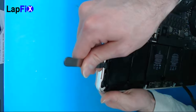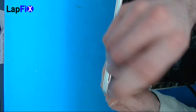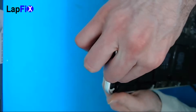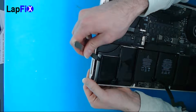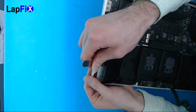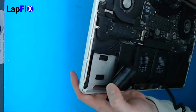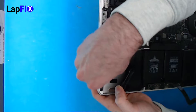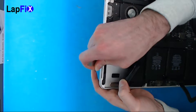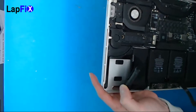You can kind of hear it rip a little bit — you can hear the adhesive coming unstuck. That's always good news. If it's still a little bit of a struggle, you can put a little bit more alcohol. You can hear it now, how it comes up and pops a little bit. Just go really slow, get a feel for it — you can hear it tearing off. It's coming very nicely. Not that much effort there. Once that's in, you can get this one out of the way. Keep spraying as you go — the more alcohol you get in there, the better. Why they choose to adhere this is a little beyond me, but if you ever did need to remove the battery, this is what you need to do — at least it's the easiest way, I believe.